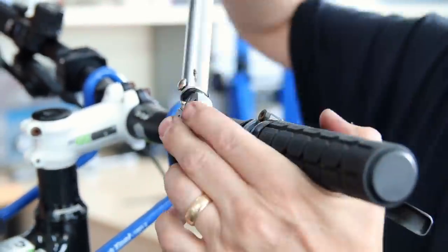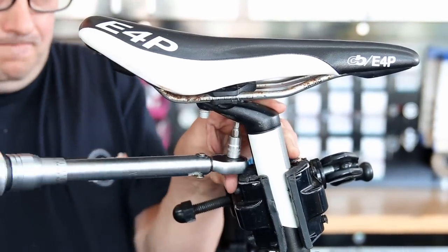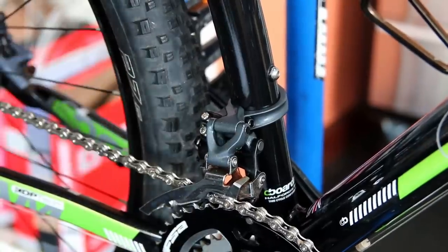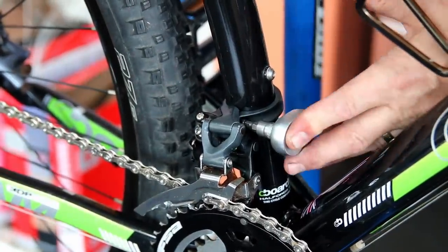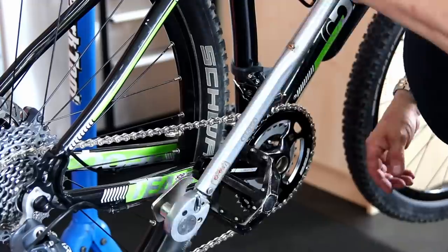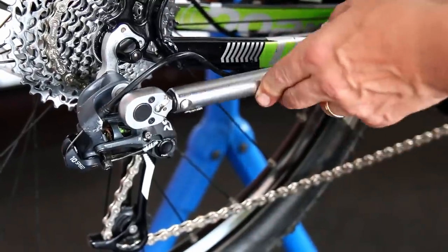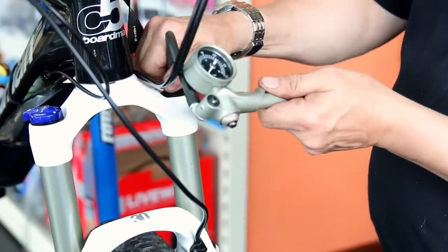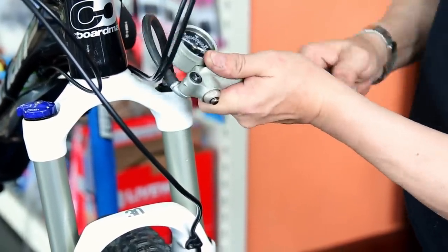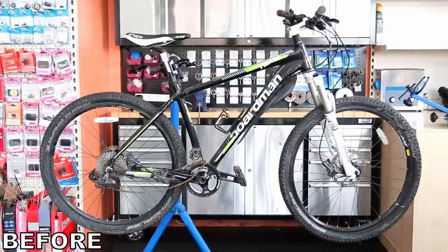We go through everything with the torque wrench — all the nuts and bolts we can reach — making sure they're all correct. A lot of these parts have their torque settings printed on them; others you learn by experience based on bolt size and what they're going into, whether that's aluminium, stainless steel, and so on. We do the pedals, all the brakes, everything is nice. We also reinflated the forks as they were a little low — we inflated them to 200 psi, which is the mid-range of the recommended pressures printed on the forks themselves.